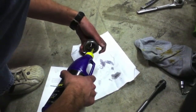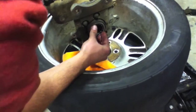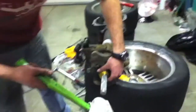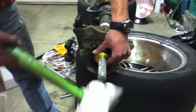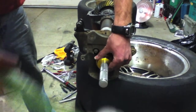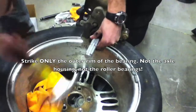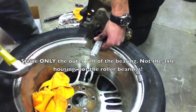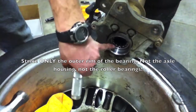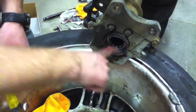We're just putting some gear oil on the wheel bearings, setting them in here and driving them in. We're trying our best to get this to go in straight. So we got this all the way in. We have a smaller one. We're making sure not to touch the actual bearings but the outer housing and making sure we're not gouging the housing here.